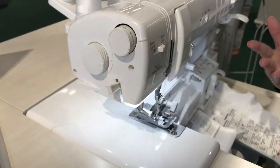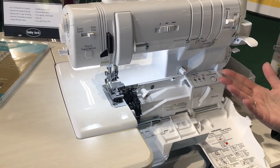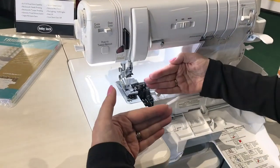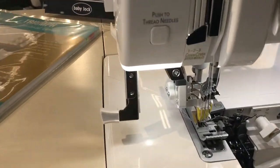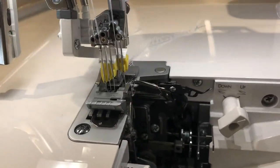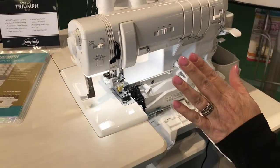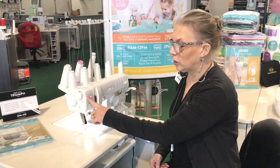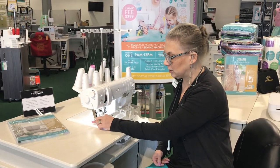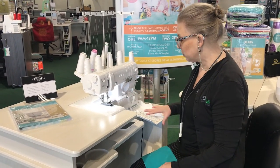When I mentioned how in the world are they ever going to thread all five needles at the same time when they're forward and backwards — well, they figured it out. The threader wraps around your needle, and whenever you put your thread lined up with it, it just sucks it right through. You tell it up here which one you're doing — whether it needs to be overlock or cover chain stitch needles. We already have ours all threaded; I just wanted you to see that up close.